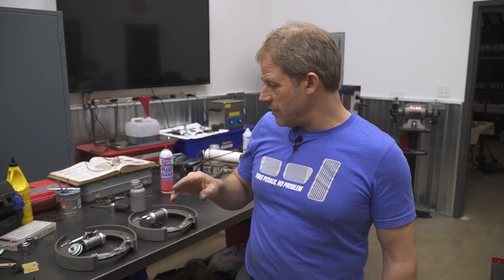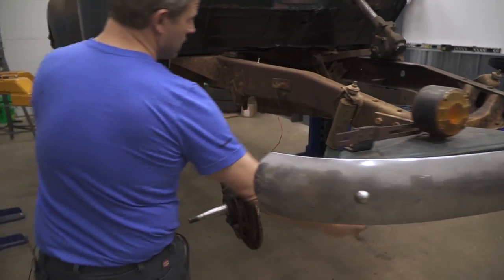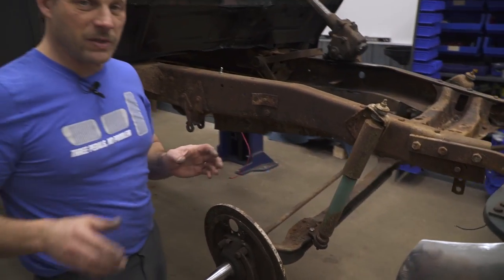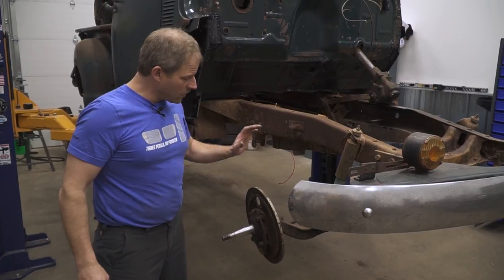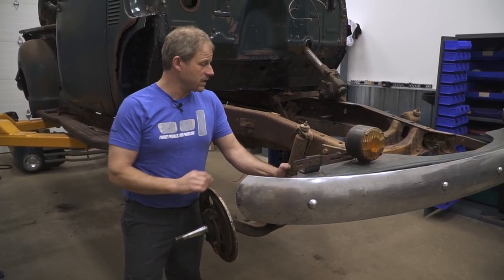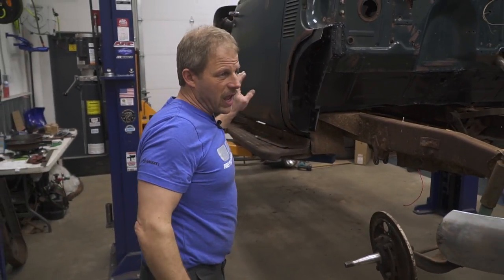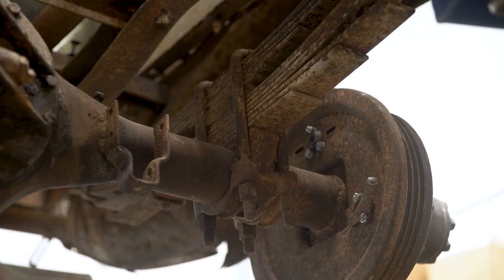I'm going to wait on installing the front brakes though, and let me show you why. I need to replace the leaf spring — the other side is broken, this one was broken too. I have some brand new leaf springs and all the hardware from LMC to attach them. I'll also wait because my king pin is pretty well shot, so we're going to fix that. And I'm going to put a brand new set of shocks on as well, but first we'll move back to the rear end and put new shocks on and eliminate that extra helper leaf spring.